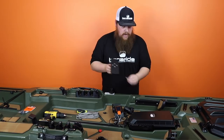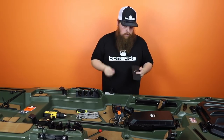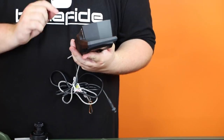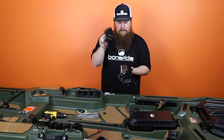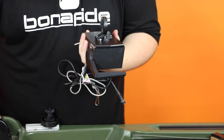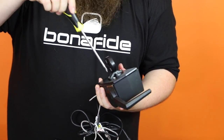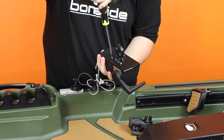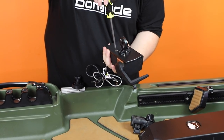Take out the spring, take out the bolt, and then included with the Torqeedo throttle mount from YakAttack is going to be the correct hardware. To do the install with your Torqeedo throttle and the YakAttack throttle mount, I'm going to flip it over and you'll see two holes right here. You're going to want to line up your mounting plate with those holes and simply drop in the hardware, then use a Phillips head screwdriver to hand tighten that. Tighten those up till snug.